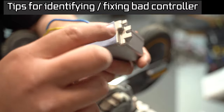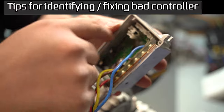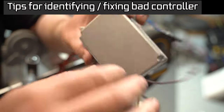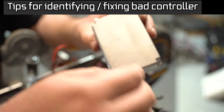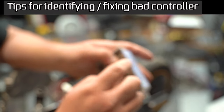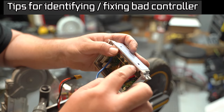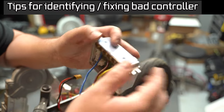To remove and replace the MOSFETs, take off the three screws underneath, remove the jelly and cut around the edge of the resin plate. The secret is to heat up the back of the controller with a heat gun — take a file and scrape along the edges to loosen it from the sides, then pull gently on the phase wires to work it out. Remove the three screws, then all the little screws off the individual MOSFETs and work that plate out first. Once the plate is out you have access to the resin in the back. Scrape the sides, heat the back, and it'll pop right out.